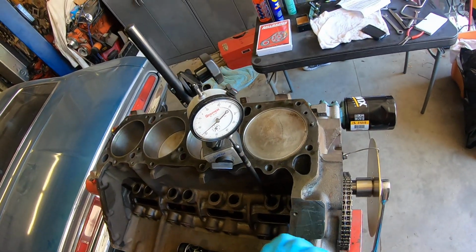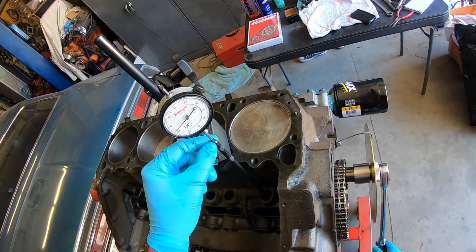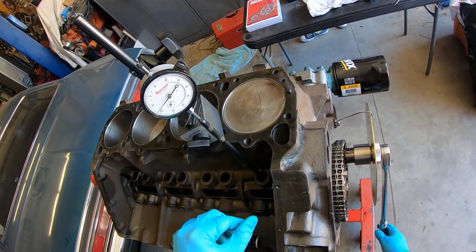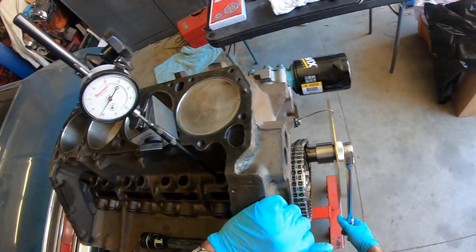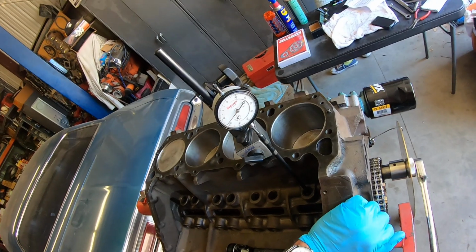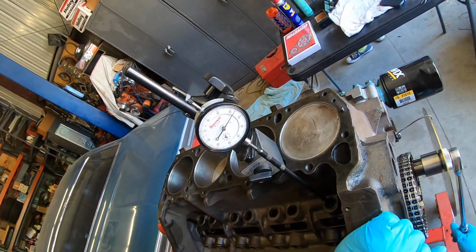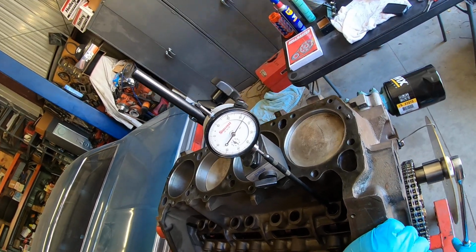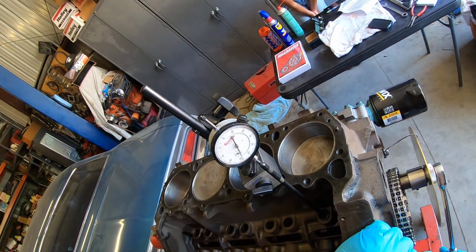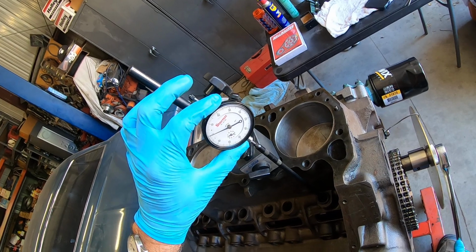It's a pretty fancy measurement push rod you've got there, Tom. Yeah, I recommend the ones with the nice end on, like the Chevy style, with the hole on each end. They fit good and they stay up there. So we're going to turn this over and go to the point of maximum lift. Maximum cam lift. You see the indicator moving in the direction of rotation? You keep going till you get to the point of maximum lift, which was right about there.